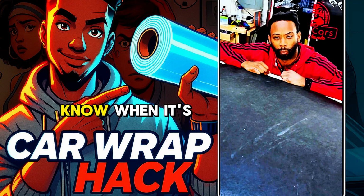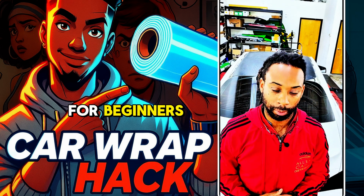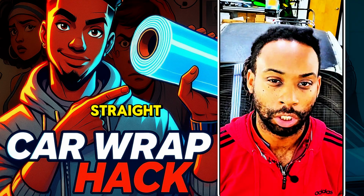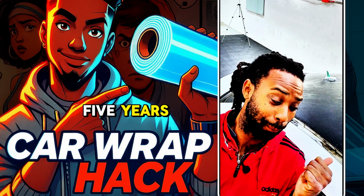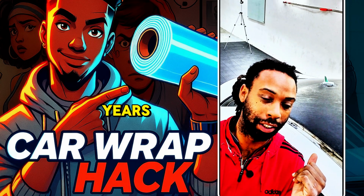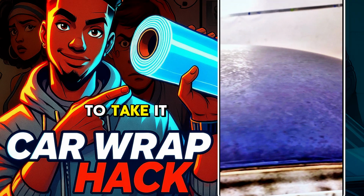When do you know when it's time to remove the vinyl off of this roof? It's been time. Day 15 on car wrapping tips for beginners, where I give you one new car wrapping tip for 30 days straight so you can perfect your craft. What happened? First off, vinyl is only meant to last for 3 to 5 years. Where it gets direct sunlight, it can actually be about 1 year to 3 years, depending on where you're at. When you see the vinyl cracking, it's been time to take it off.